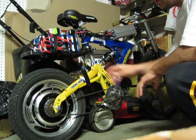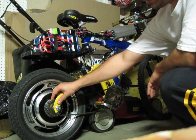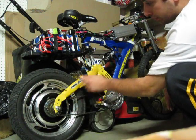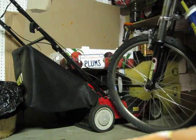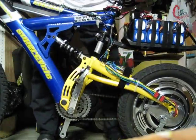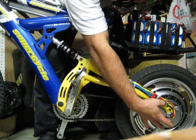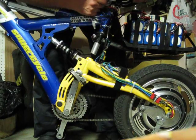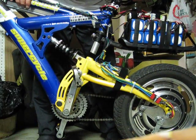I took everything off and pretty much put my 16-inch Golden Motor on. It's got air cooling on the inner side on this side and the other side. Phase wires are probably about two or three inches and the relays are there as well. I used the factory phase wire from the motor to here and these are all 10-gauge wires right to the relays, and then again 10-gauge from the relay all the way to the 18-MOSFET controller.